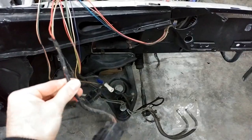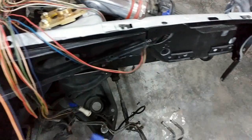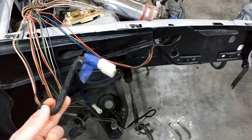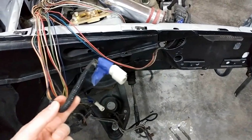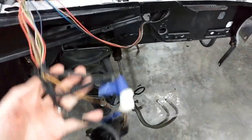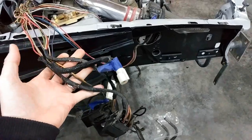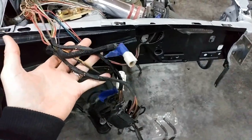If you look at the wiring here you can start to see some of this madness. You've got two relays here that don't have to be in the engine bay — these could be pulled back into the cabin. And then you've got a couple of other plugs here for airbag crash sensors that worked on the '92 but won't work on the '80. So all of this — two relays and two crash sensors — can go into the cabin and get out of the engine bay.